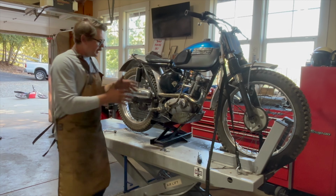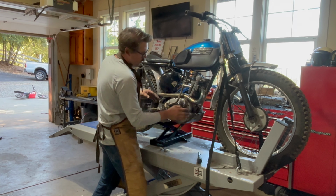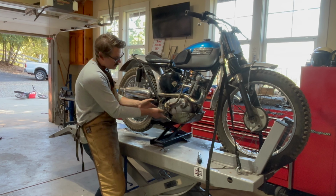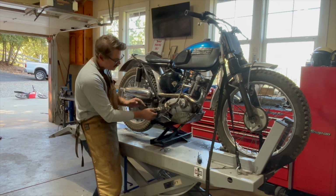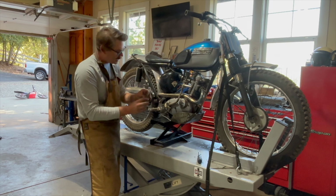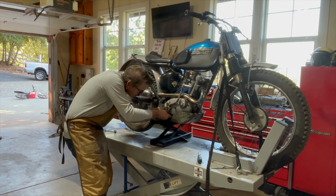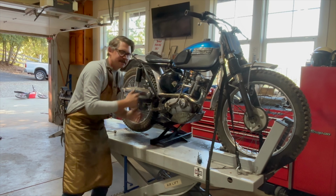Okay, I finally got this thing bent the way I want. I've got the front hook or hoop drilled and that's mounted. And I'm really happy with where this ended up. It matches the curve of the frame. It butts up nicely to my cuts and the hooks are ready to go in. So I've got the surface all cleaned up with the flap disc. I'm gonna take these hooks, place them where I want them, the top above the frame and the bottom resting on the skid plate. I'm gonna try to sneak the welder in there, tack it in place.